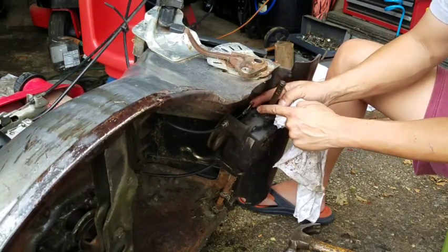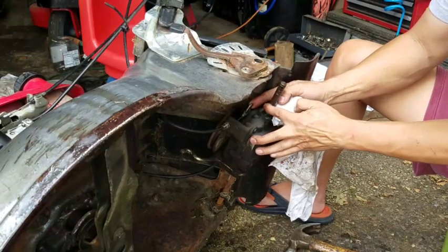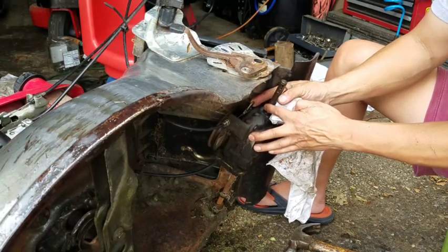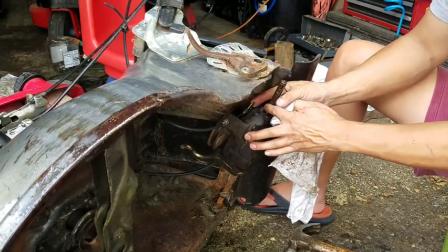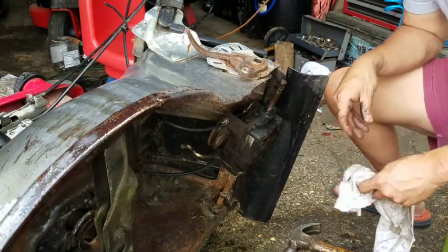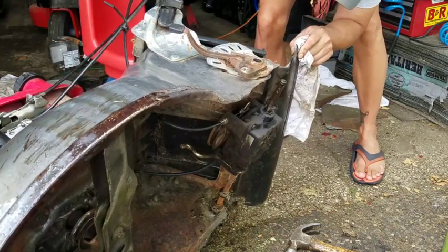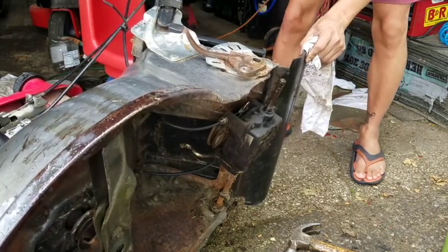But I've seen videos of the guys just pulling this back all the way over here, you know? This is actually only about an inch and a half or so. But it's supposed to only go like that much, you know? Like half an inch play. But the play is almost a full inch and a half. But I think that still might be okay though. I just need to tighten this belt more so that when I pull this thing, it goes much more than that.